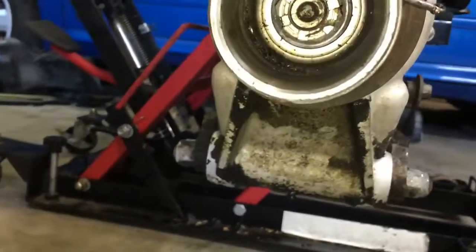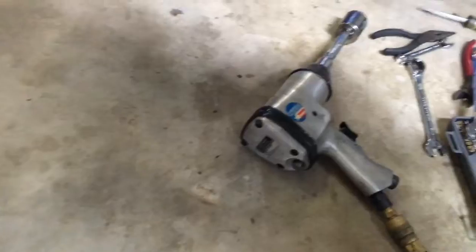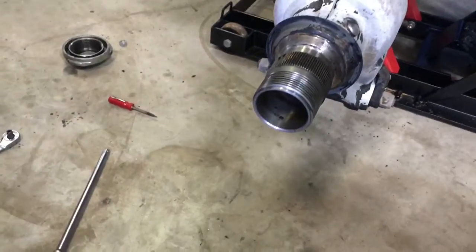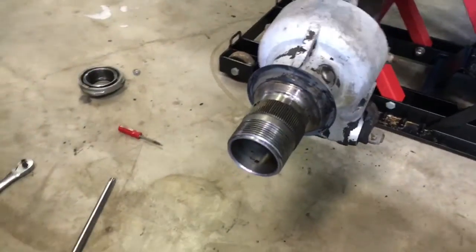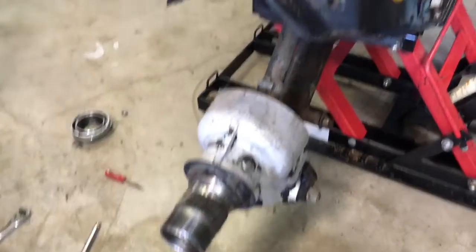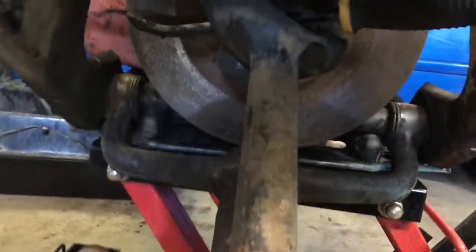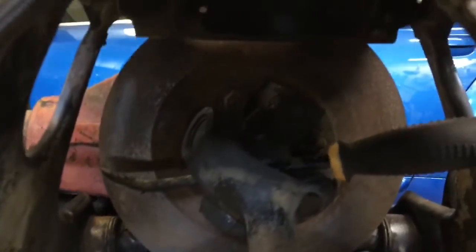Make sure I see what size nut that is so we can loosen it up. Alright, got both of them out. Using the air gun at 150 psi. Seems like if you do lots of pulses, eventually it pops off, but we got those. So now I've got an 11/16 socket with a 1/2 inch drive. I'm gonna go ahead and bang off those bolts holding the disc brake on that I couldn't get before.